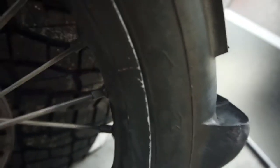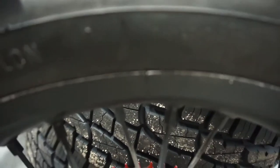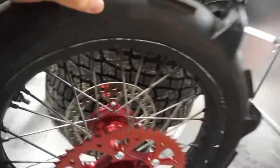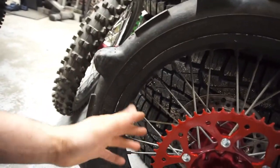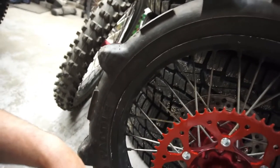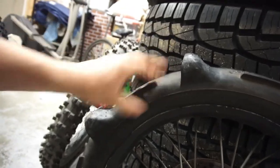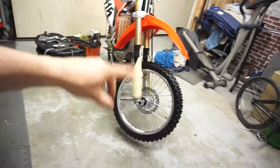The rim does have a crack in it — I believe it's on both sides. You can see it a lot better here — there's a good-sized crack right here. The rest of the wheel is fine. You don't have to crank those rim locks down like crazy — they were really really tight when I took the tire off. Someone put about 60 foot-pounds of torque on it, which you don't need. I have 20 PSI in this dune wheel, and about 12.5 in the front and rear of the actual bike.